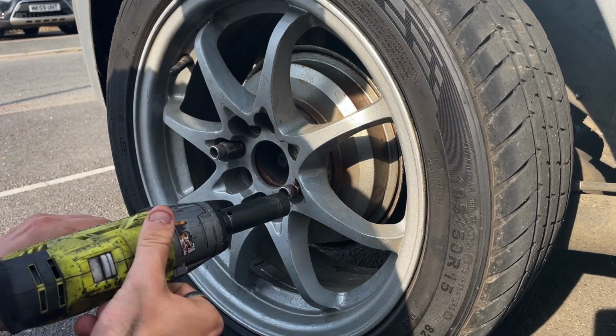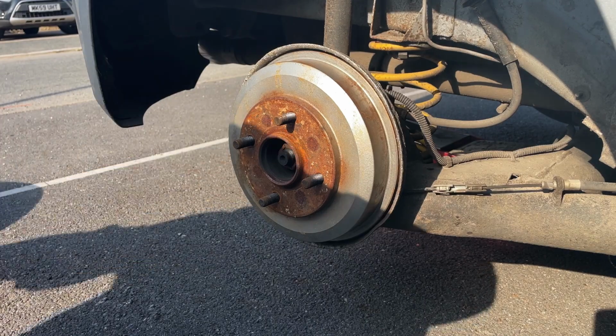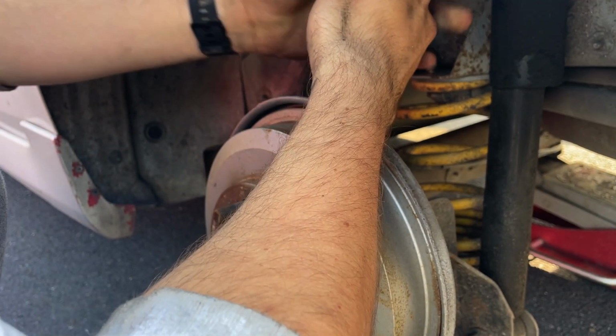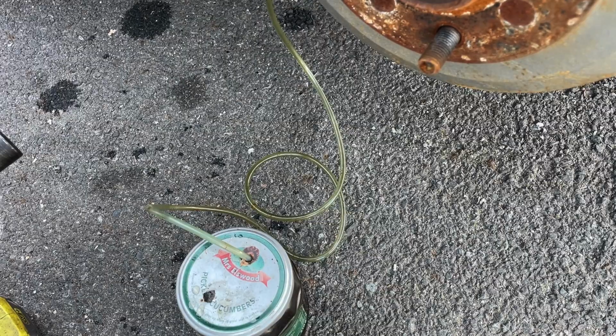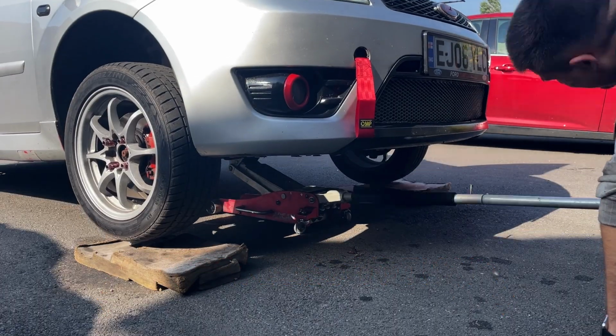Now to bleed the brakes. Start at the back, and you should start on the wheel that's furthest from the reservoir. Crack the bleed screw loose, then get someone to press on the brake pedal, then tighten. Repeat this over and over until no bubbles are seen. I do have a full guide on my channel on how to do a two-man bleed method.